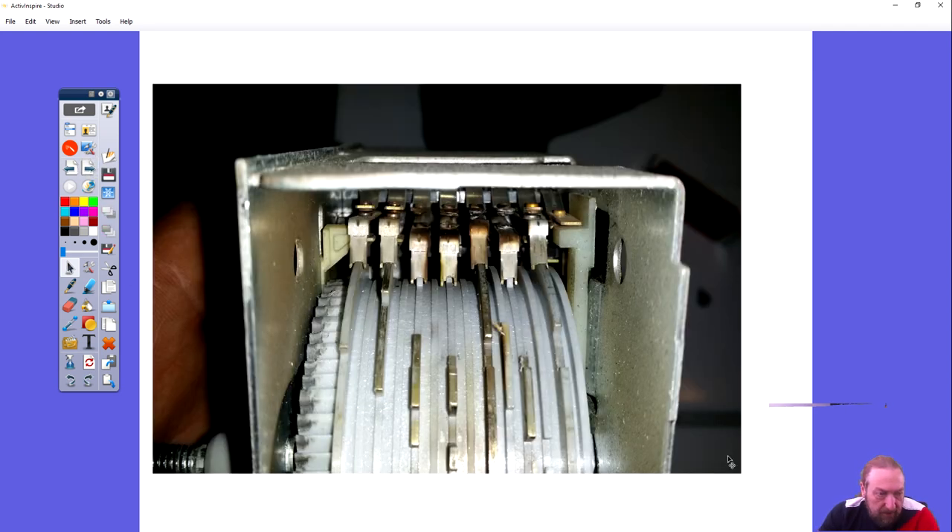This is the inside of your timer. Each one of these rows is a cam. This is a cam, this is a cam — each one of these, going on so forth. Right here it's dropped down, but right here it's raised up. As the timer advances, you can see the teeth — the timer motor uses something called an escapement.